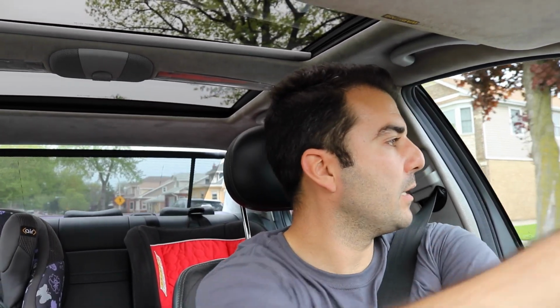All right, guys, so the downshifts are actually pretty harsh. Let's try and put a little bit more throttle. Okay, so 1 to 2 feels totally normal. 2 to 3, yeah, let's see. This is like eighth throttle. Okay, very nice, very crisp so far. But I will say this, the downshifts, yeah, you can kind of see me move a little bit. They are pretty harsh going down. It kind of feels like maybe a little rev match would be nice. So maybe that's something that can be messed with in the ECU or the TCU tune. But I think a rev match on the downshift would make them feel a lot nicer.